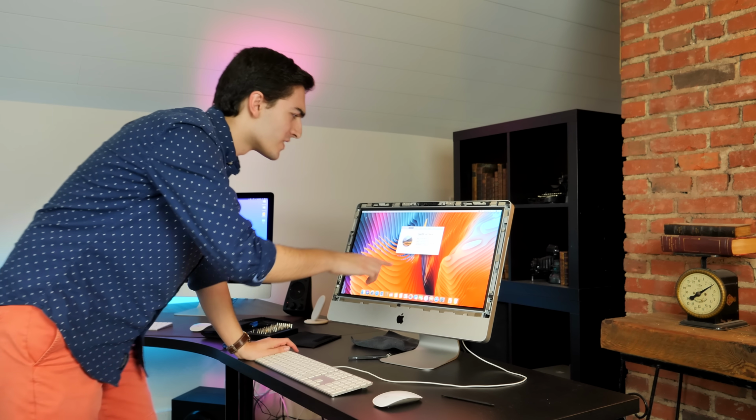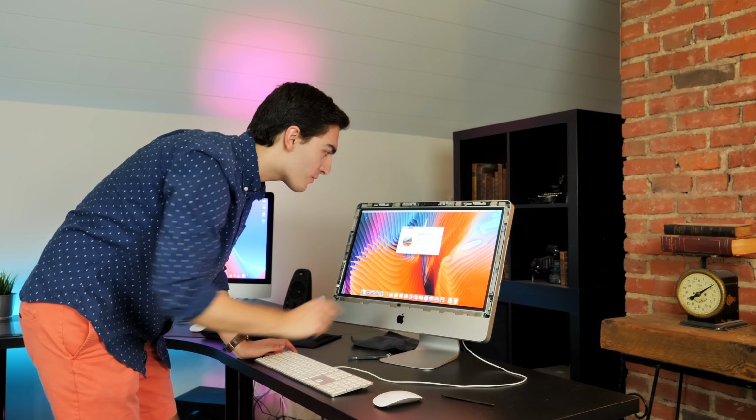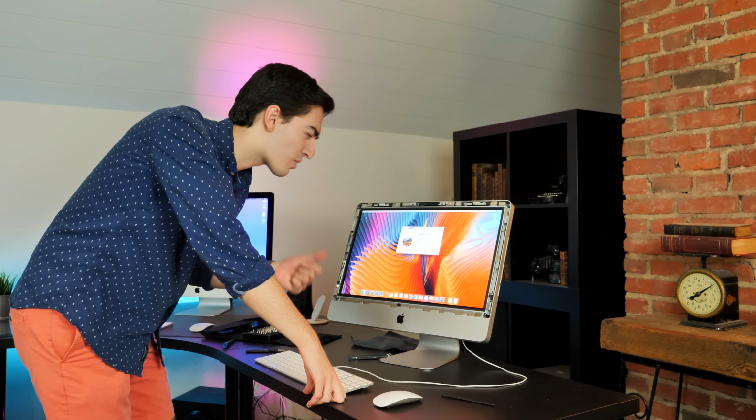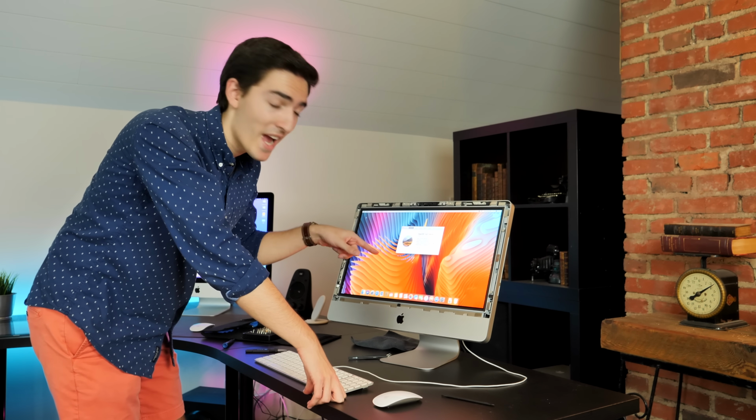Okay, that's odd. So it's reading as NVIDIA GeForce GTX 770M 3GB, but I put a 765 in here, so I think it's probably reading the VBIOS of the card wrong and displaying it as a 770. That's probably what's going on. I'm just happy it all works at all.